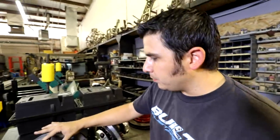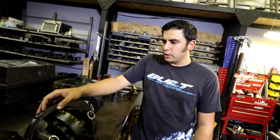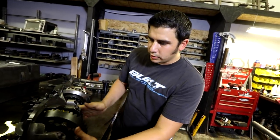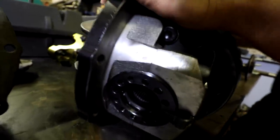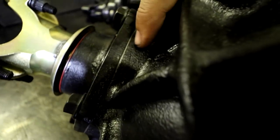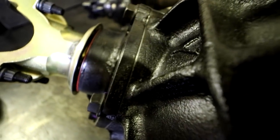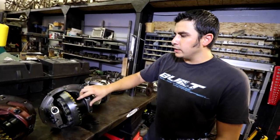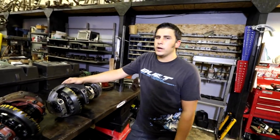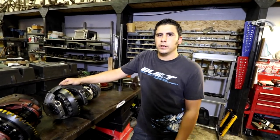Yeah. What we didn't touch base on, Mr. Gearman, was the paint. What's with the paint? When you're setting these up, you're trying to get the gear in its happy place so that it stays quiet and lasts as long as possible. As you adjust, that's what these carrier adjusters are here for, it moves the gear side to side. And then you have these shims, if you can see them, in between the pinion support and the case. Just that little line of silver right there? Yeah, so between those two adjustments, you hone the gear in exactly where it wants to be. It'll last the longest and be the quietest. And the paint, what it removes, will show you where it's riding, and you aim for the perfect pattern there. Gotcha, to get it to last long.